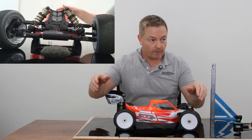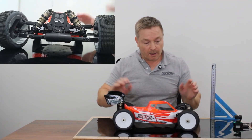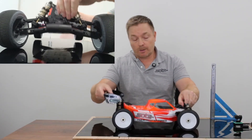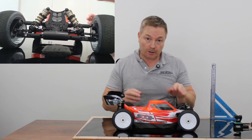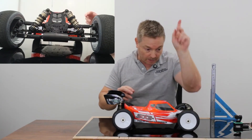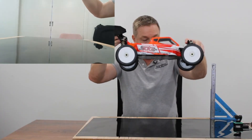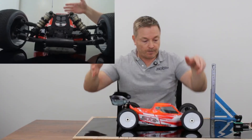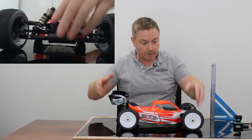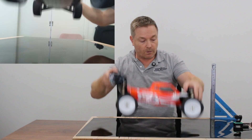Even though they're thicker oil, they return well. It has the additional rebound — the shim does bypass that circuit, so it doesn't necessarily go through the red insert. It'll follow the path of least resistance. I haven't touched this since the last time I used it, and I could go all day with this.